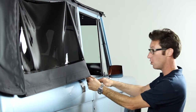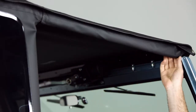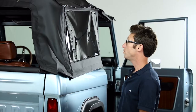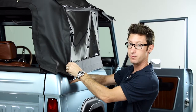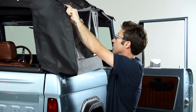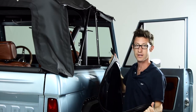Once you have the lip pulled out, go ahead and open up the door, and you're going to want to pull the lip out of the channel around the window. Very easy — just reach up and pull the top out of it. Once the window's been released from the channel, come to the back of the truck, undo the Velcro, and you'll find the zipper tucked behind it. Just run the zipper all the way around. The window comes right out. Once it's out, just repeat the process on the other side.